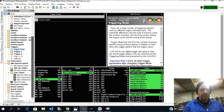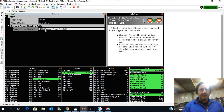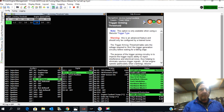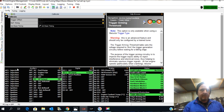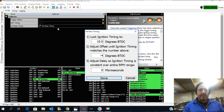Going back — it would backfire because I put individual coils on it. In trigger 1, it's a reluctor, so that is correct, and there's the voltage threshold it needs to generate before it registers a trigger. I've already checked it and we do have triggers. Reluctor, level 2 — those figures will work fine. The problem comes down here in calibrate. This will work fine if you're running the factory ignition with the minus four setting. But for individual coils it will not work. So we click into 'set base timing' — that locks the timing at 10 degrees. Once the setup is running in a vehicle, no matter how many times you've done it, you should always check your base timing, because sometimes it catches you out.